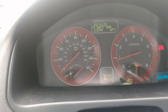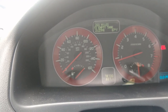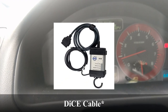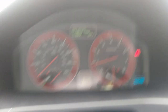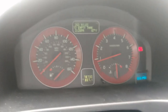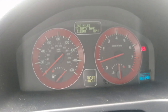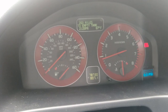It's similar to measuring blocks on Volkswagen cars, although I think it's a little simpler. I actually purchased the cable you need for Vida in order to sniff the traffic it was sending onto the car's bus, see what it was doing, and see what data was coming back. I was able to use that to develop my own method of sending those messages, receiving the data, and doing something with it.